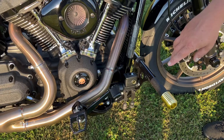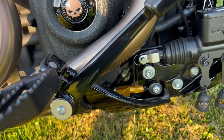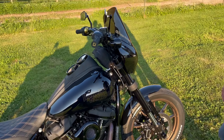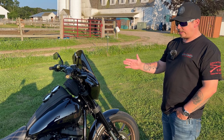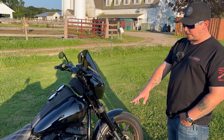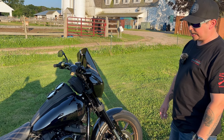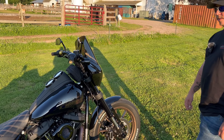A neat little piece down here is made by Green Brothers Designs — this is their brake bone. Probably the biggest complaint on this bike is the lack of rear brake performance, largely due to the leverage you can't get on the factory one. You feel like you have to point your toe down to get good leverage. Green Brothers makes different color brake bones and offers a huge adjustment range so you can bring that pedal up and get a lot more leverage. That was a huge upgrade for riding the bike and getting better performance.